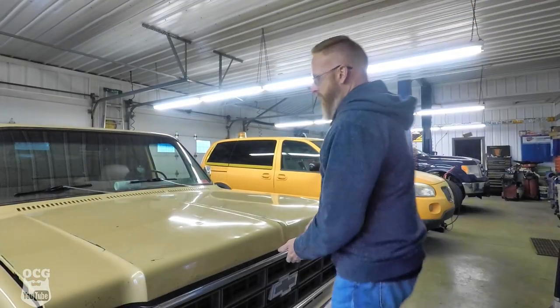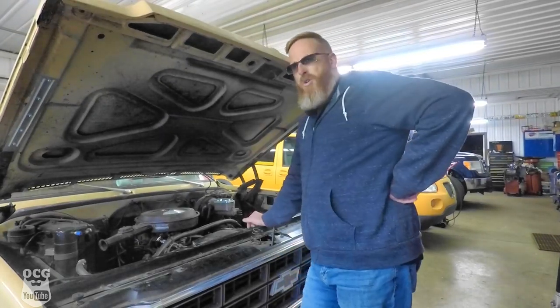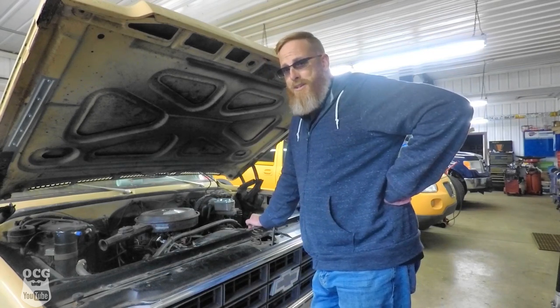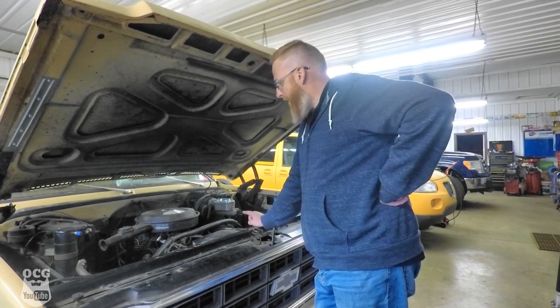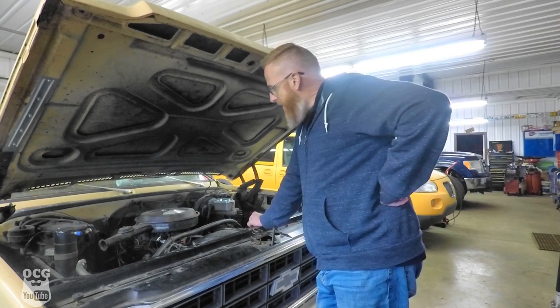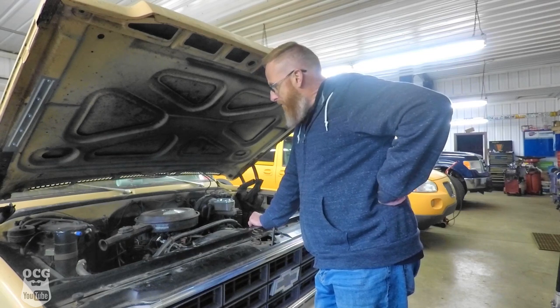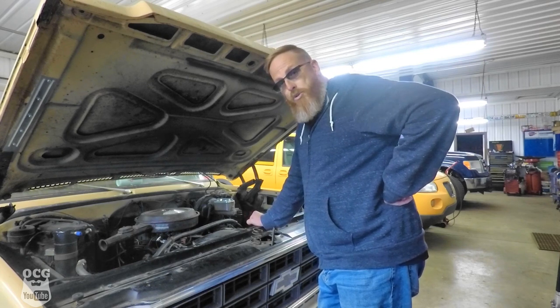Today, we're talking about Dale and, well, why he's actually parked in the shop. And it's not because I want to be driving the Volkswagen. Let's take a look. So on Saturday, I was out for a drive and I started noticing a little bit of a noise, and at first I thought it was an exhaust leak. Then it became very reminiscent of the first time I broke a rocker arm. So tonight we're going to tear into the valve covers and take a look and see how many or which one seems to be the issue. So let me get this tore apart and I'll bring you back and we find out which one's bad.